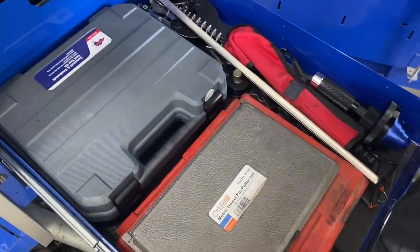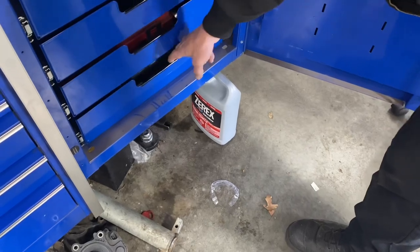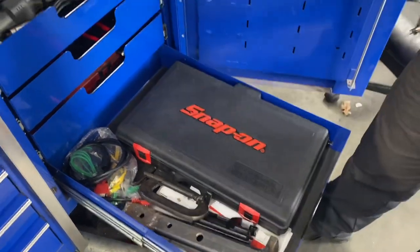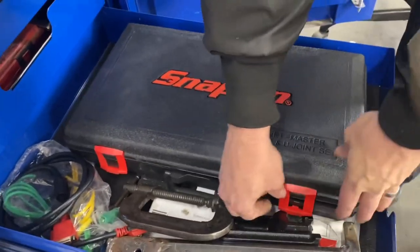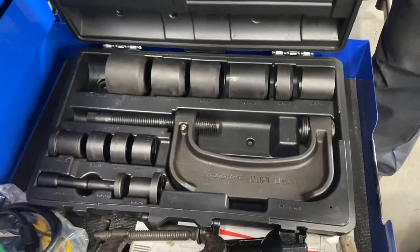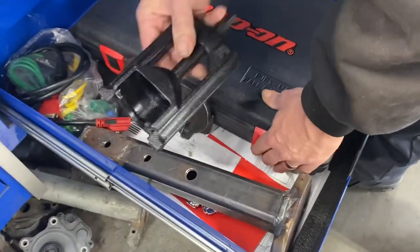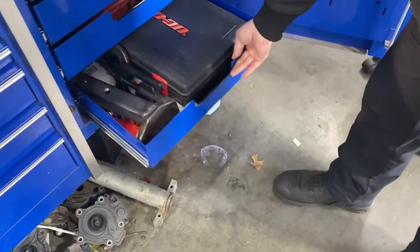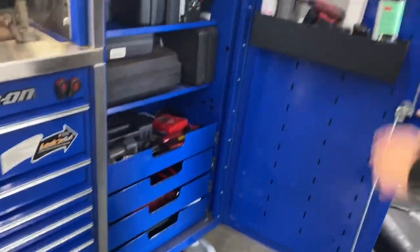Pullers and installers — mostly ball joint and hub stuff. That big Snap-on one — yes, open it up real quick. I got a lot of attention on YouTube for this thing. Everybody commented how crazy expensive it is, but it's well worth it — it does it well. This is another thing that actually isn't that expensive, but if you're doing a lot of U-joints, this is the tool to take them off the drive shaft without hammering. That tool's fairly cheap. Various chemicals and whatnot.